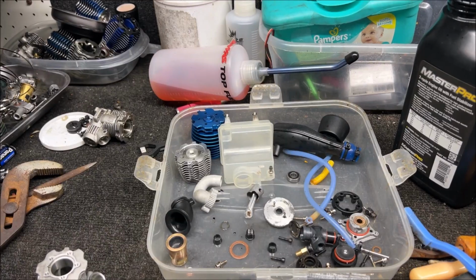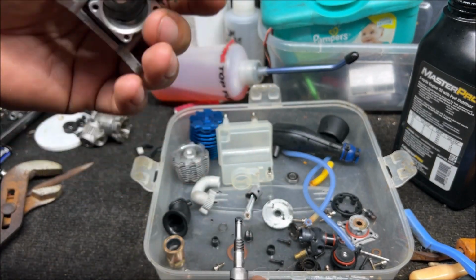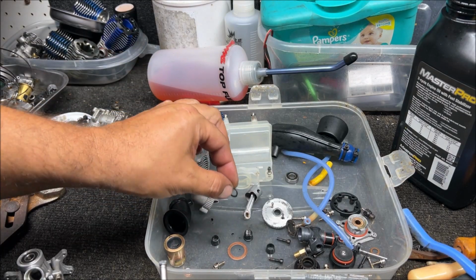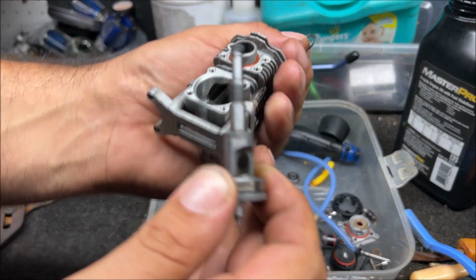It's so tight. All right, so I've already taken this thing apart like 5, 6, 7 times, because when I was putting it together and tightening up the flywheel, it would get crunchy. Couldn't figure out what it was, but I did notice this part. It's a coated washer, but it's a little bit bigger. I tested other flywheels, other bearings. I changed that front bearing out.